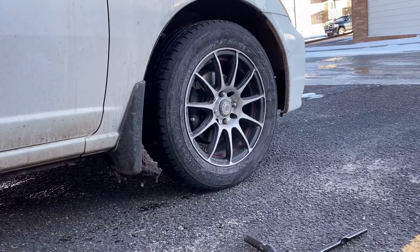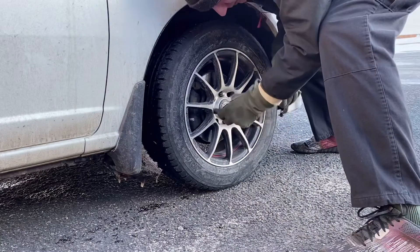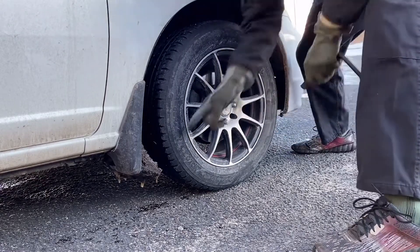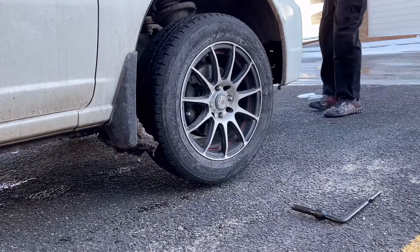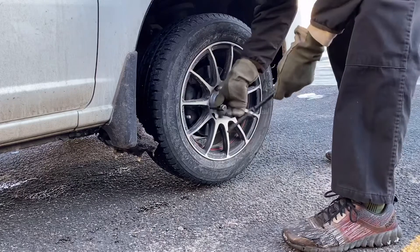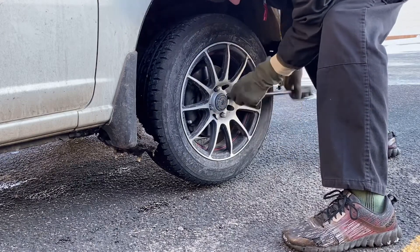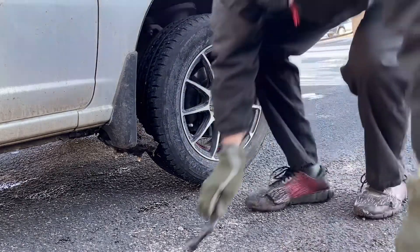This is a 2002 Honda Civic. Like every time we jack a car up, we're gonna break the torque on the lug nuts before you raise it off the ground. As you can see, that's ice — it's cold. I suspect it's water in the caliper guide pins causing them to stick when it comes to sub-zero or close-to-zero temperatures, but I don't know until I get it apart.